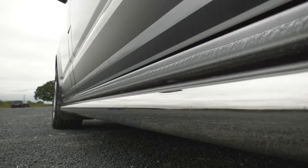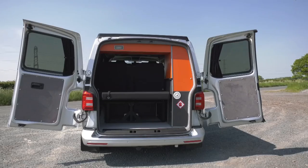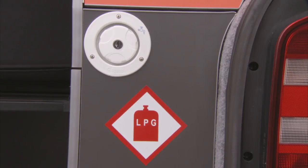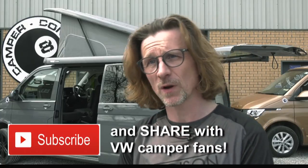And the last of your utilities: water. Most vans will have a water tank with fresh water hidden away somewhere inside. In our vans you get an 18-litre internal tank that fills up from the back — it's got a little electric pump that pumps out when you pull the tap. The big thing to remember is winter: ours has a drain tap underneath so you can drain it all the way down. It shouldn't freeze because the tank is inside the van, but some people fit external tanks and you've got to worry about that.